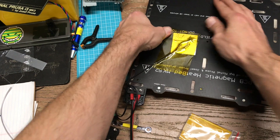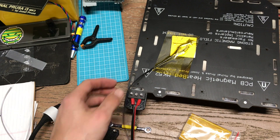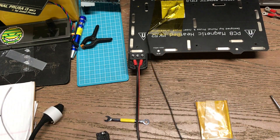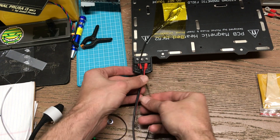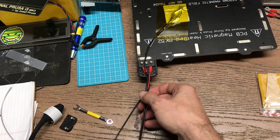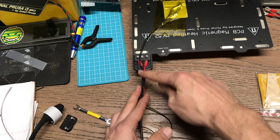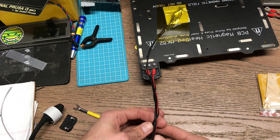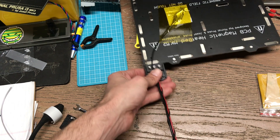Now our thermistor is repaired, but we do need to complete the installation by properly securing our wires. If you don't twist the wires, just from the effects of friction they can work themselves all the way out of the machine — it will literally just suck this out, and then you'll start getting errors. It doesn't actually damage the sensor, it just won't work. And you're like, where did my thermistor go? Well, it's inside of your harness.